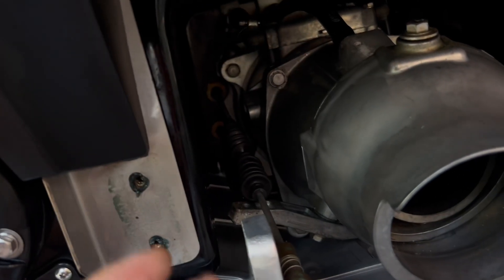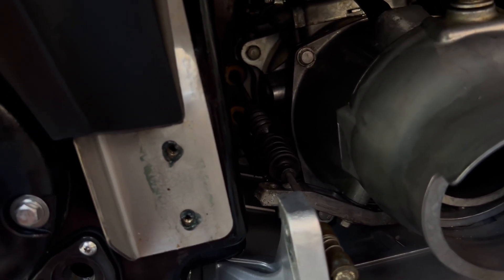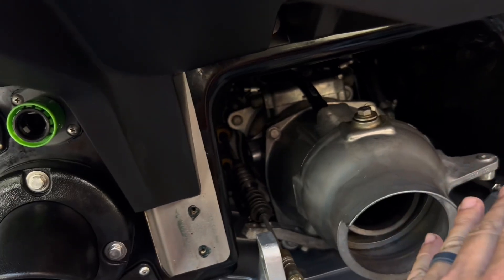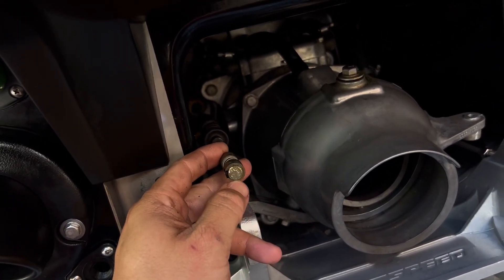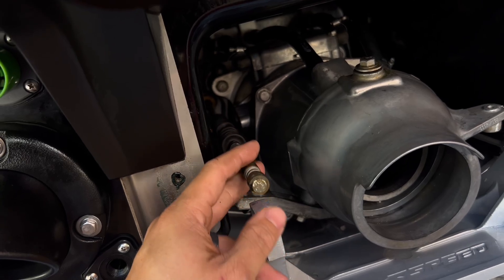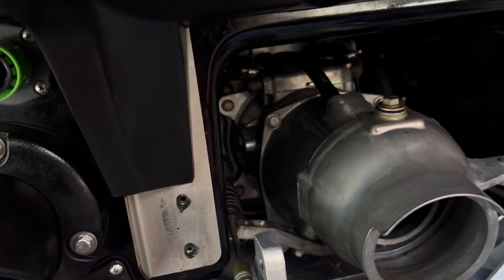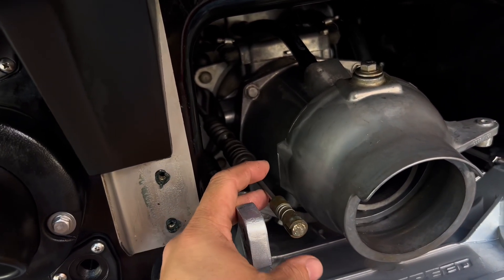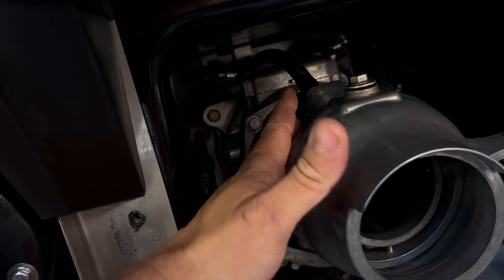With any anode, you want it to be contacting the metal surface directly — no grease or insulator between that anode and the surface. I'll keep checking that anode, and when it starts to wear, that'll be my indication that it's time to be replaced. I removed my step and my reverse bucket. On a 2022 Plus Ultra 310, you will have to put the ski into maintenance mode to extend the reverse bucket actuator in order to remove the quick connect coupler. If you have a pre-2022 Ultra 160, Ultra 310, or STX — current model STXs as well — you can remove this manually without any maintenance mode and add that sacrificial anode to your jet pump.